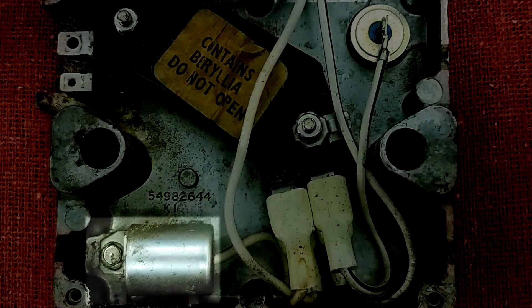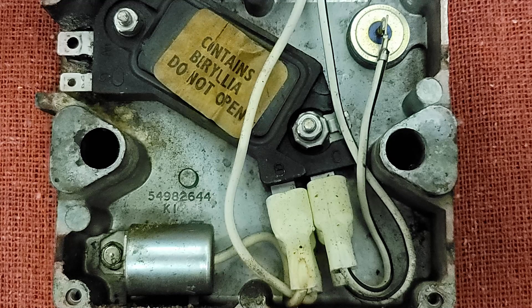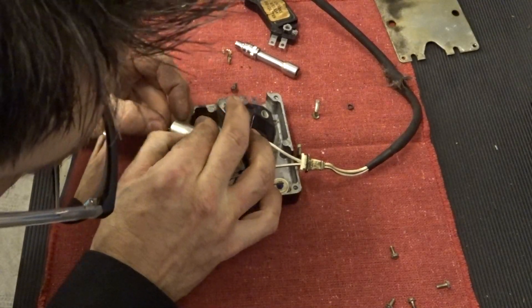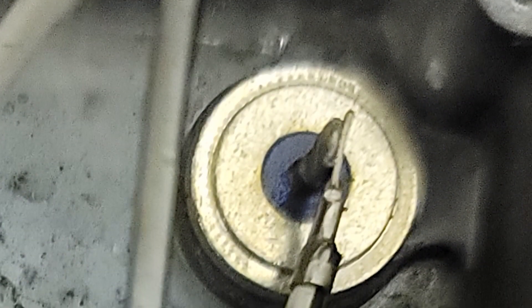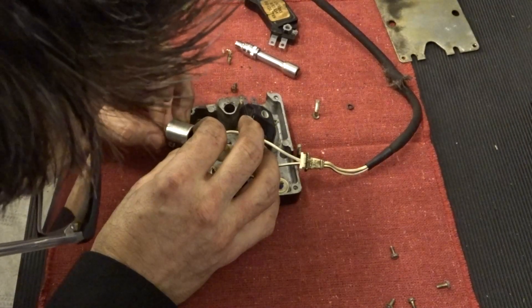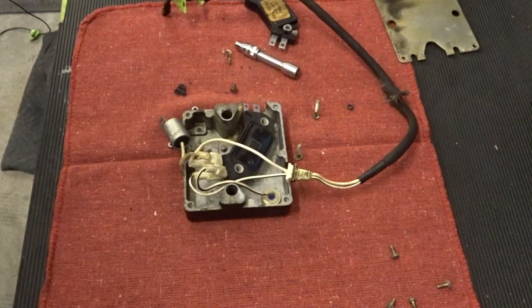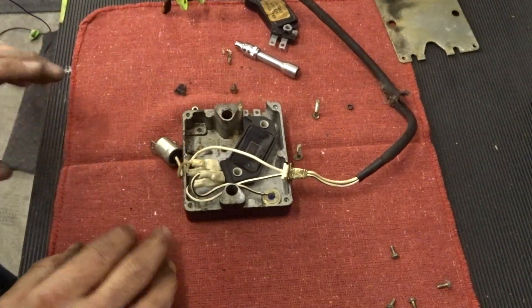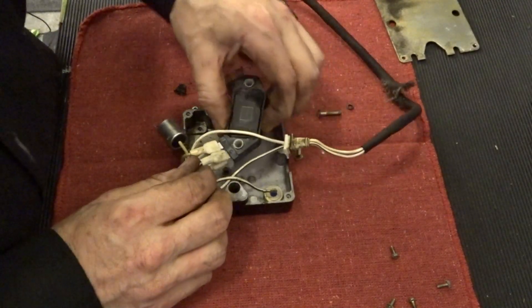Original versions of both the 1MF Lucas condenser and the 350-volt clamping zener diode do not appear to be available. However, I will link to some sources for alternatives in the description. Usually these parts are fine — the condenser is mainly used for radio frequency interference suppression, and the zener diode serves as external protection for the module, mainly used in the case of spark energy that has nowhere to go, i.e. through a disconnected coil end. Before mounting the module, I want to get some thermal paste for the heat sink to help with thermal transfer between the module and the base, hopefully extending its life.